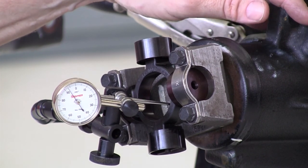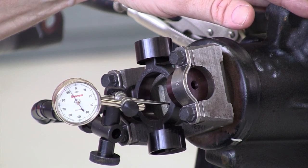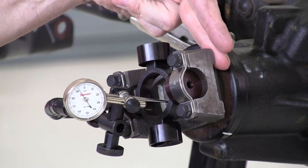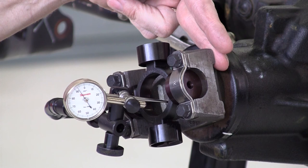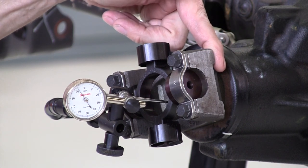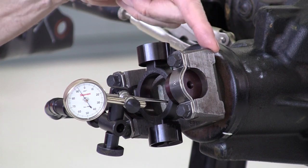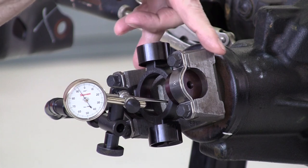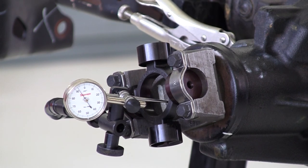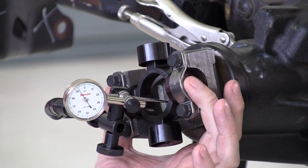This is a crushed sleeve style axle, and crushed sleeves are not reusable, so that's a lot of work to go through to determine if you have a bent flange. I have seen many times over the years technicians hit the back of this flange with a hammer to remove it, where just a good steering wheel puller — or the GM special tool — will remove it. Hitting this with a hammer is not the approved way, and I have seen mushroomed-over metal from hitting it so hard. That's where it had excessive runout. This type of runout will create one shake per revolution of the propeller shaft or pinion flange, since they all spin the same speed. This axle has a ten thousandths of an inch maximum runout tolerance, not as tight as the other axle.